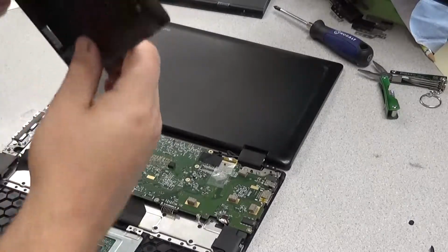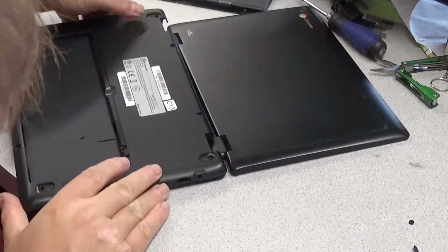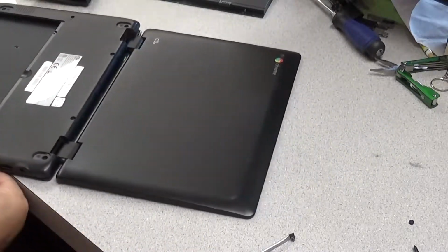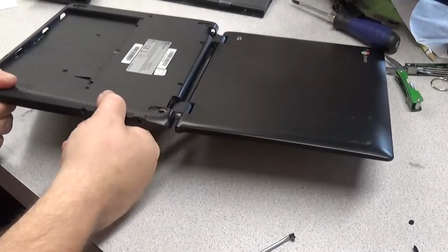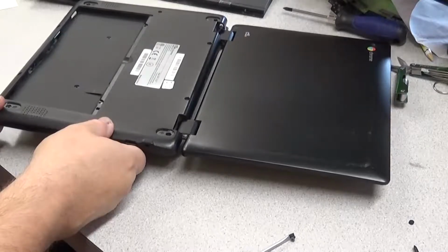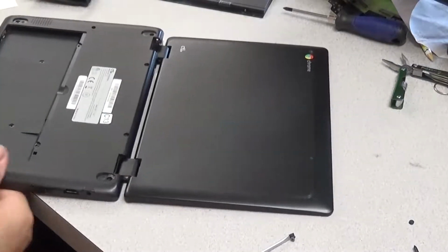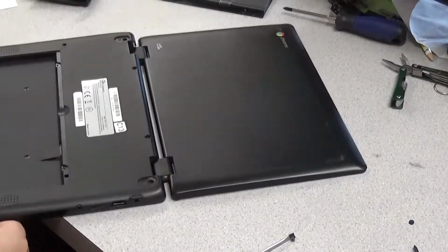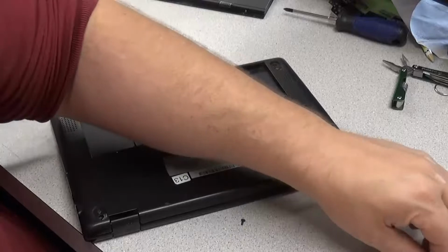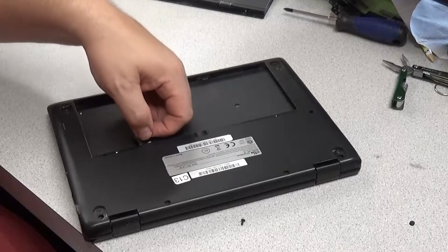And now we put on the back, and we start on the side where the audio connection is. Again, this is not always so easy. Sometimes it pops loose as you're putting it back on. Major pain in the butt. But I suppose once you get good at it, you can do it many times. Snap, snap, snap. Put the 2 screws on, put the 8 other screws on, flip that underneath the power connectors.